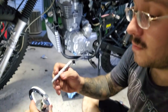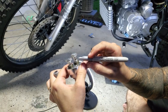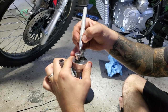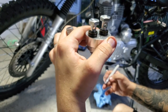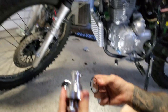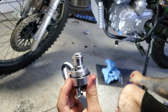Now we're going to mount this part right here where your oil filter screen cap used to be. I'm going to use a metallic Sharpie to draw a line to keep note of orientation of where the holes are going to be when I mount these lines. All of this hardware should have come in your kit from Amazon. Make sure you take this gasket and put it right there — that's going to stop your oil from leaking.